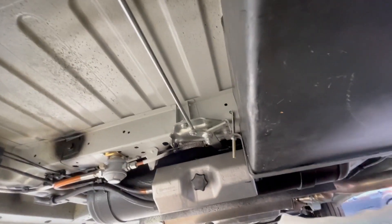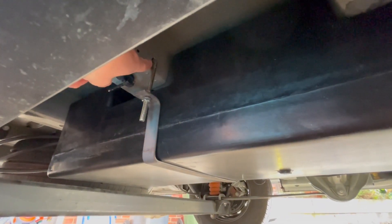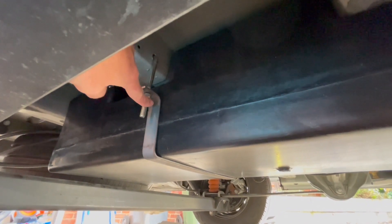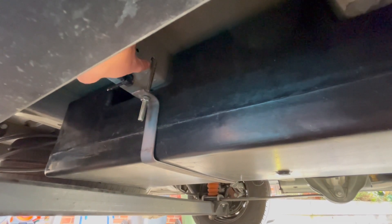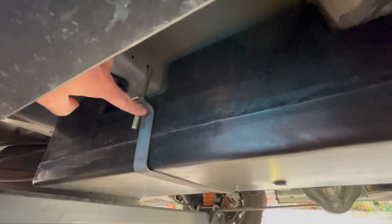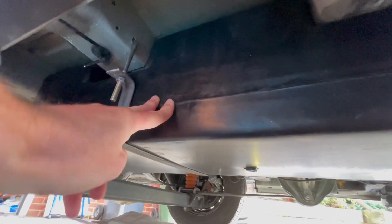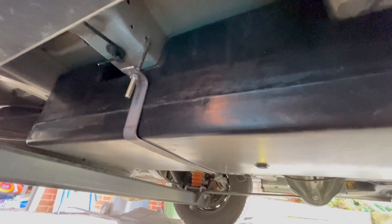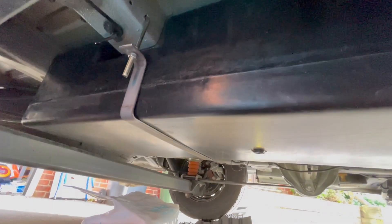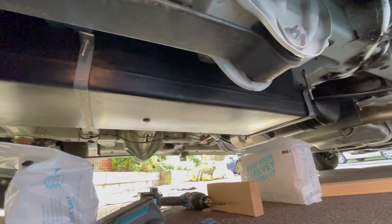It's not ideal but it does avoid the mechanism and it does hold the tank nicely at the front. We've got a brace at the very front and then the second brace is here — again drilled holes to hook into — and that's holding it up quite nicely. You need to be careful about how low the holes come: they need to be quite low so the hook will hook in without making too big a hole, but high enough that you don't run out of thread as you're tightening up. But it seems okay. I'm actually pleased — the tank is now in place.